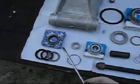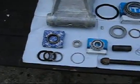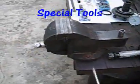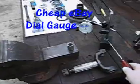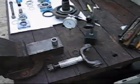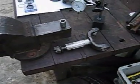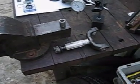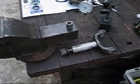For oil seals I'm using this one piece seal instead of the old fashioned multi piece. For normal tools you'll also need a vise, a decent vise, some dial gauge — you could use feeler gauges but dial gauge is easier — and I'm using the end of the driveshaft to set the end float, plus a spacer for the fulcrum.